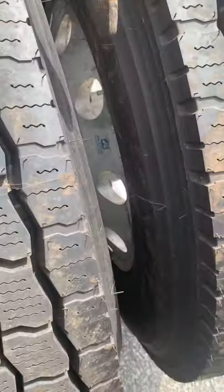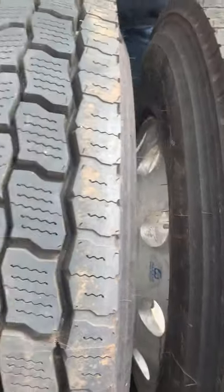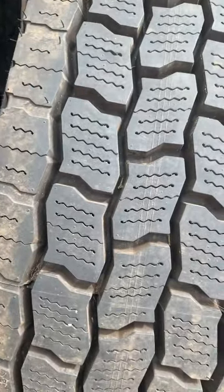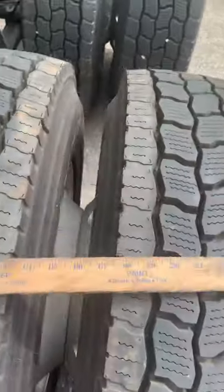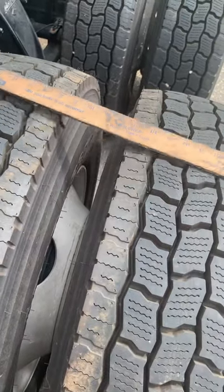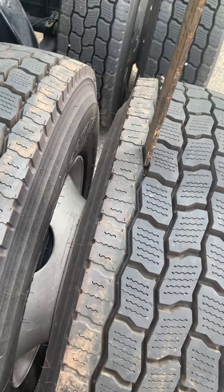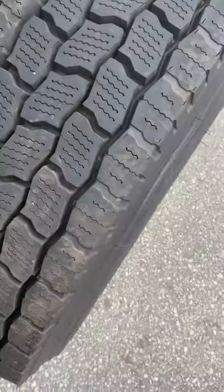From there you're going to go to your tire sidewalls — inner and outer. Tire sidewalls are both free of damage such as abrasion, bulges, or cuts. Then tire face. Both tires are evenly worn with no damage. Both have a minimum tread depth of 2/32. Both are properly inflated to the manufacturer's specifications.